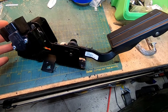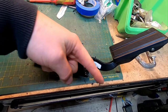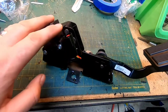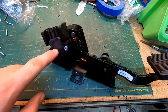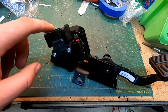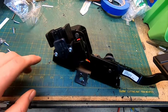This is the pedal assembly out of my truck — actually, this is a new one. As usual, I'll put a link down below in the description to parts and pieces that I used, but I do want to talk about these sensors. There are two sensors on this pedal assembly. This is the throttle position sensor, which you can replace on its own. You can find these parts at Amazon or Ford or wherever, and I've read that you probably want to stay with the Ford brand because they're a little bit better than some of the other brands.